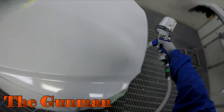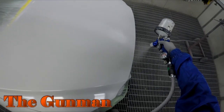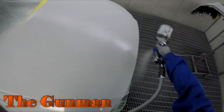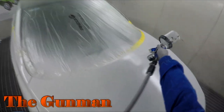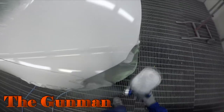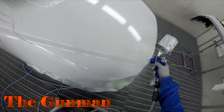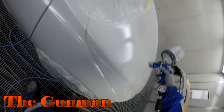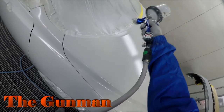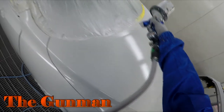Fairly straightforward procedure really. We did all the prep work, finished it off with 800 grit on the orbital sander, then did all the edges with 1000 grit — as I've shown you in a fairly popular waterborne prep work video I made recently. I've decided I'm going to do another updated version of that because I haven't covered an area where I've had to block primer and stuff like that. People seem to like the prep work videos — something a bit more than just watching me spray cars.